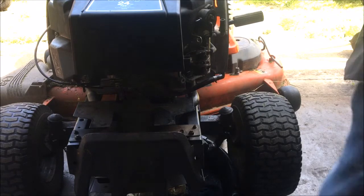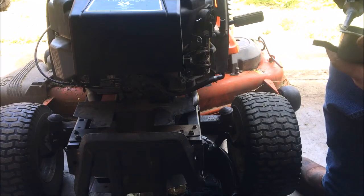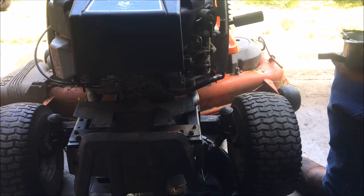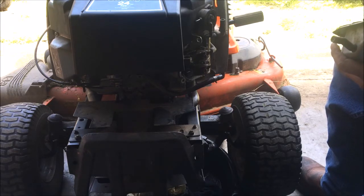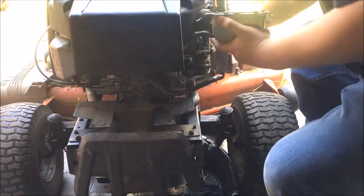So what I'm going to do now, I'm fixing to get ready to put the silicone glue on the valve cover. And then we'll reattach the valve cover to the head. Assuming I can get the glue to come out. I think the glue I got's a little old. Hopefully it'll seal off and won't leak. But I just bought this RTV glue today, so we can be hopeful. Alright. Nice thin coat all the way around.